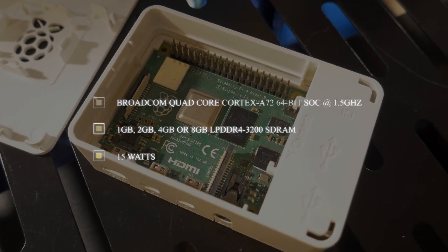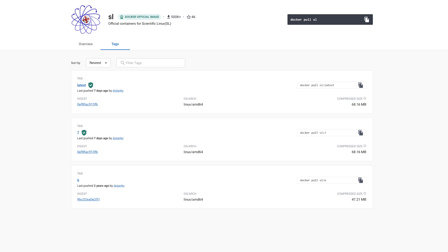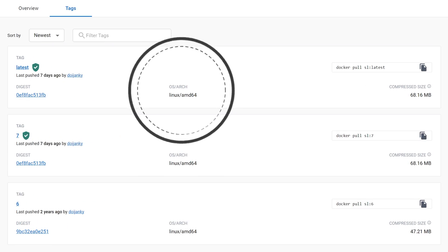The Raspberry Pi 4 is powered by a quad-core Cortex-A72 processor clocked at only 1.5 gigahertz. So not only are you not getting very many cores, but they're also low-powered cores, which may cause issues with certain tasks or compatibility with Docker, Kubernetes, or whatever platform you use. Oftentimes, developers only compile their applications and containers to work on an x86 platform. If you run into that situation, you've got two options: skip that container or application, or learn to compile applications yourself for the ARM platform and hope everything works correctly.